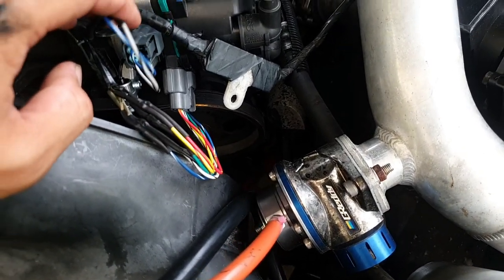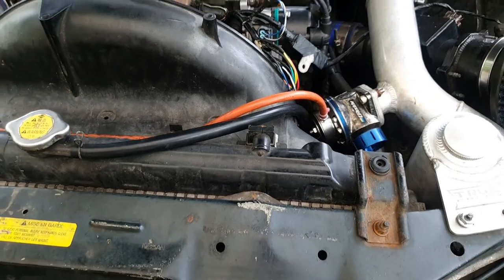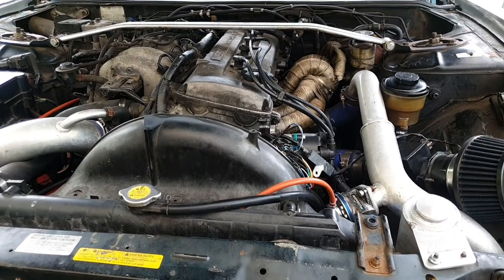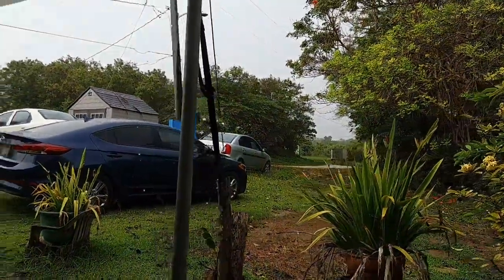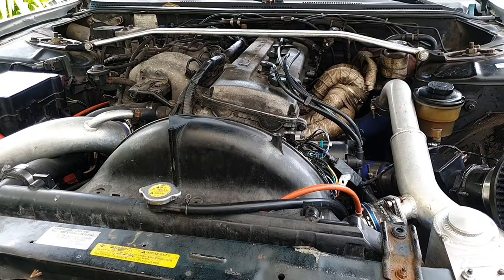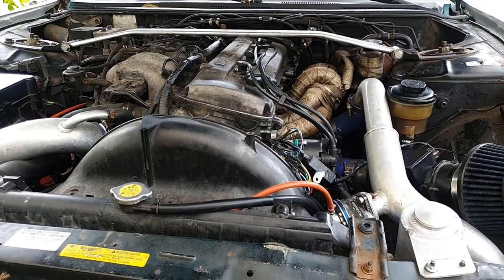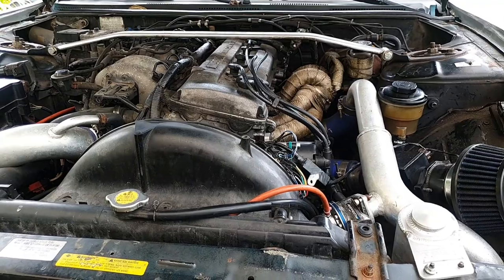New connectors soldered to the harness. I'll clean it up but I don't want to do that until I actually try to start the car. I'm not hoping for a perfect start — I'm hoping for a one-shot, one fire and it to keep running. It's kind of gloomy right now, it's freaking raining. Guam's weather is pretty crazy. I took a little water break and I'll get back at it. Hopefully she fires first time, and if not, I've at least ruled out the connectors — now I know it should be making good contact with the distributor and ignition coil.